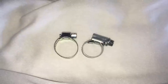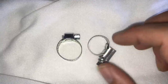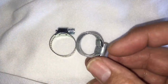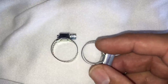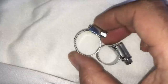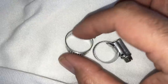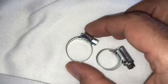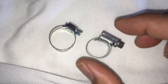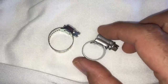The problem with jubilee clips is a bit of a poor design — a lot of them have a square block on the back of the worm drive and that creates an uneven circle. You can see this one has got a little step here so it doesn't pull up evenly and it leaves you with a little gap where water can squeeze through. And the trouble is when you do them up there's a fine point between doing them up enough and doing them up too far, because you can actually make it completely worse by over-tightening them.